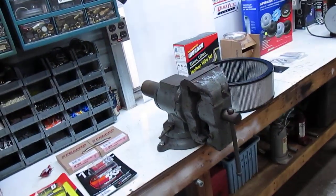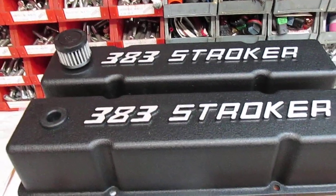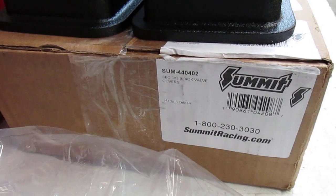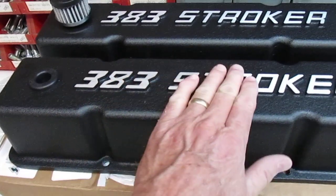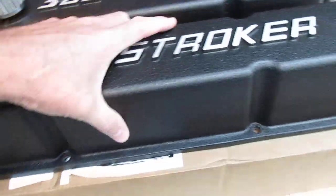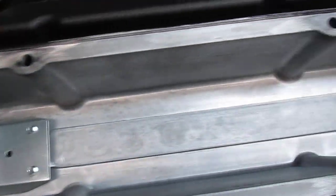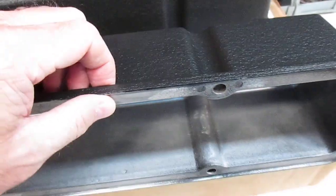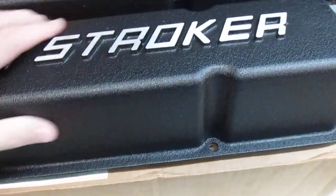In the meantime I've been gathering peripheral parts. I found these really trick valve covers from Summit Racing — model number SUM-440402. They're cast aluminum, the 383 stroker logo is raised, and I chose the black wrinkle paint finish. On the inside they have a nice baffle and they're tall, so there's plenty of room for roller rockers and possibly even stud girdles. I saw them at the Summit showroom and was really impressed.